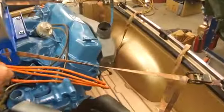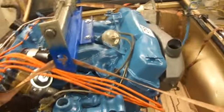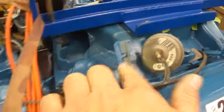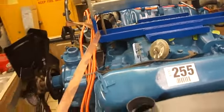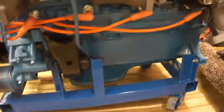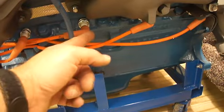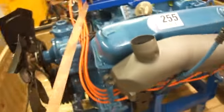Anyway, as you can see, I got Mopar spark plug wires, the orange ones, and they're almost right. Everything on this side of the engine is fine. This side, they're all a little bit short in all reality. Oops, I got a wire caught there. I'll have to move that later. They're supposed to route from the distributor, there's a holder there, then to here, and then down to here. So they make this winding path around the back side of the AC compressor, essentially, and then around to the back. One of them is different, the angled one, and it's supposed to come around the dipstick, but they're just long enough that I can make them work.